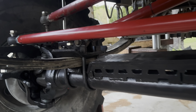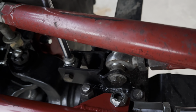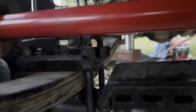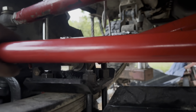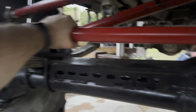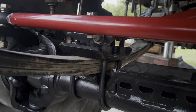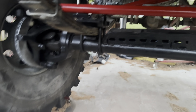So that contact was a bit of a pain. Everything's loose right now so I can rotate it, but what I was able to do was cut down that bracket and move the hole in. And now I don't have contact, even past bumps. The only place where it could possibly hit is if you rotate it down you can catch on here. This isn't tight either, so that bolt will be up higher, but when it's tight it'll stay pretty much in place. And if I all of a sudden start getting a lot of rotation, I'm just going to cut this perch back a little bit.